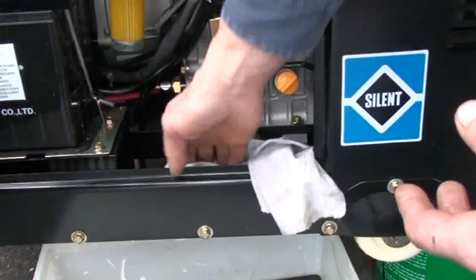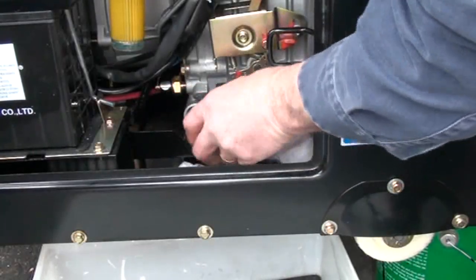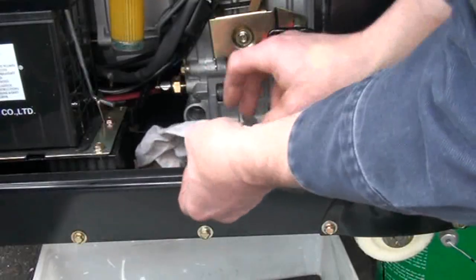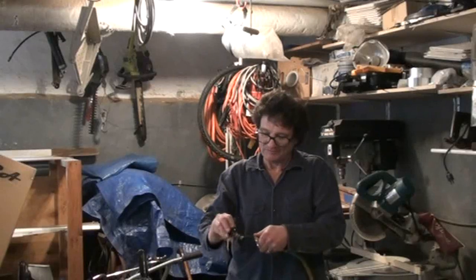I'm going to use the rag to clean up the drip tray from the oil change — a good idea before throwing it out. Now, if you watch Aurora Ron's video, he stresses the importance of getting the oil strainer seated in the correct way, or you won't have oil pressure. Make sure it's seated all the way with the screw hole aligned. We've sprayed it with solvent and used a small plastic brush or old toothbrush to clean out the metal shavings, and the last step is a blast of compressed air.